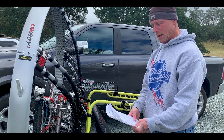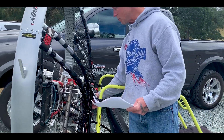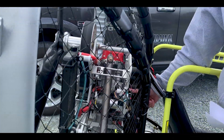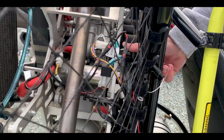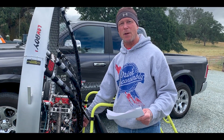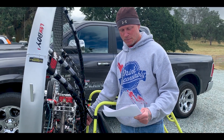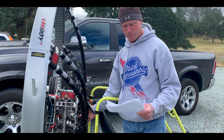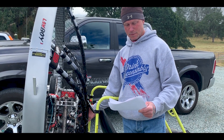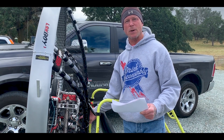It says turn on the ignition by moving the switch to the middle position. The switch on mine is set up on the back here; some of yours might be mounted down here. When you turn it on, you'll hear the fuel pump cycle, and that fuel pump cycles for about five seconds. We'll go ahead and turn it on — fuel pump is cycling. Once it's cycled, we'll go ahead and turn it off.